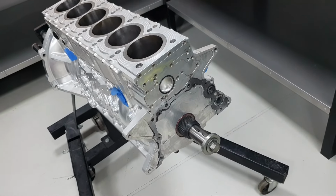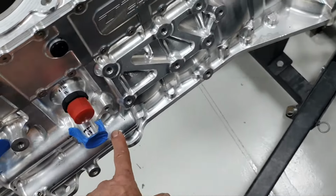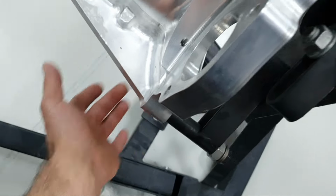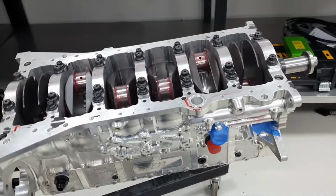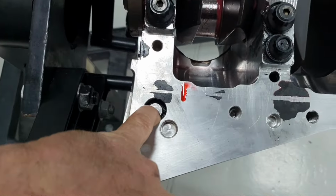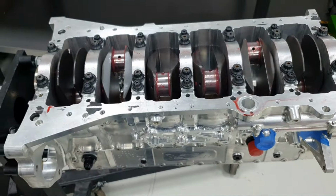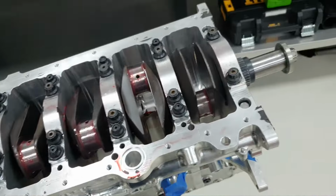Now, removing the crank. What does it take? First, the M6, these two M6. Then there are some other bolts here that are from down. I'm gonna show you. The last will be the mains. That's the thing. Like I said, first the two M6 Allen here, then 13 M8 actually here, and then the mains in this order. On the cooling jets, yeah, all right.